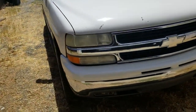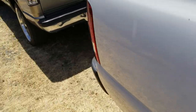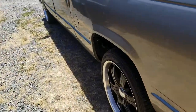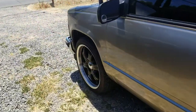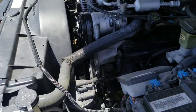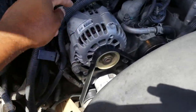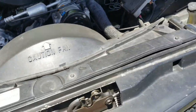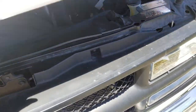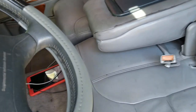One's gonna go in this truck with my 04 Suburban. I got an older harness from Nelson for it because I had them pack them up. The other fans are gonna go in the OBS crew cab truck. I got my Centurion and got the AC in it working now. Time to track down an alternator for this thing - a little more power. That was a 124 amp, I want to run at least a 145 or 160.